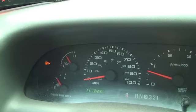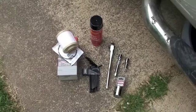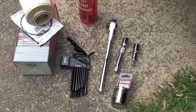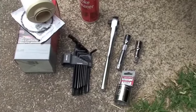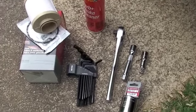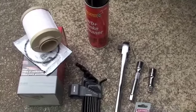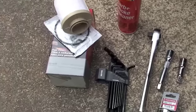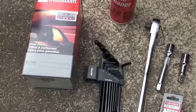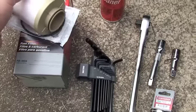Hopefully this works and makes the light go off. From what everybody says, it just takes a few parts. Hopefully you got them at your house. I didn't have the 36mm socket, so I went to Sears and got that. That's going to take off the actual fuel filter on your rail, on your frame. Got a half inch socket, some extensions, 6mm Allen key, some carb cleaner for cleaning out the inside of that fuel water separator, and then the actual filter. I've left Motorcraft just because I like to stick with the Ford parts in case anything goes wrong - I know that they'll be readily available.